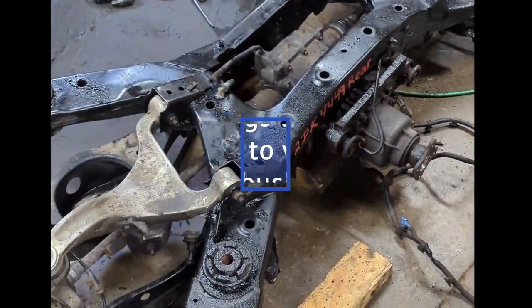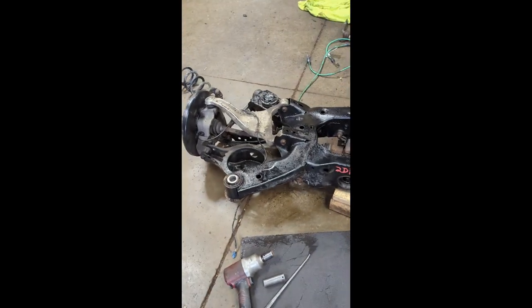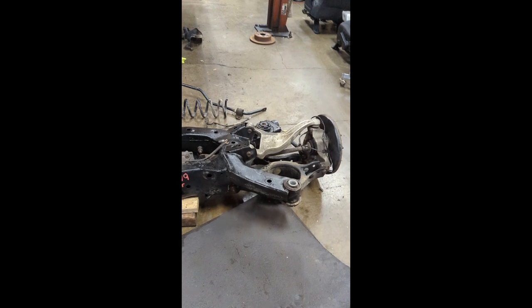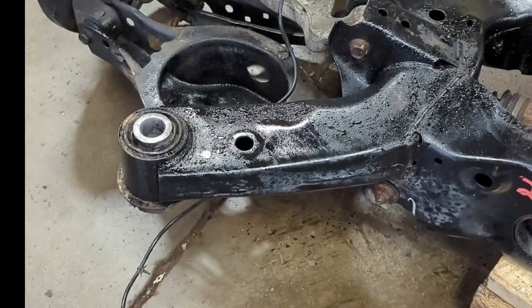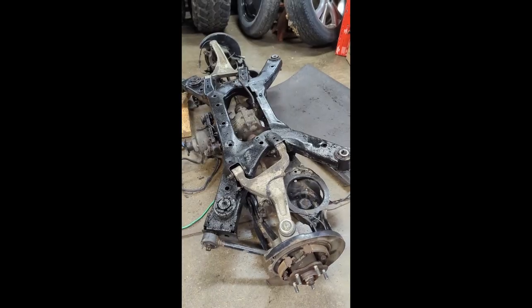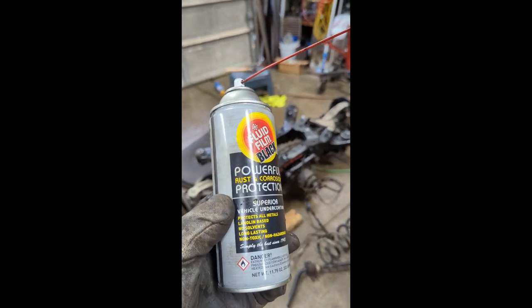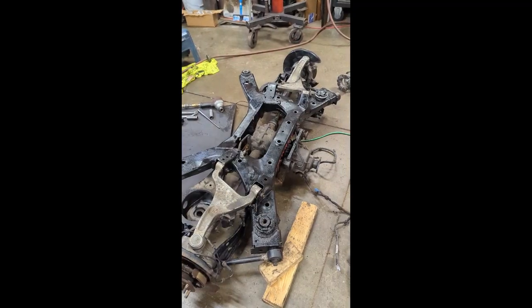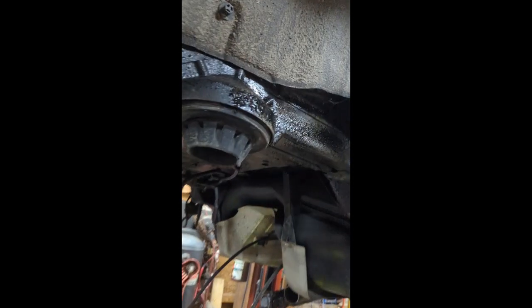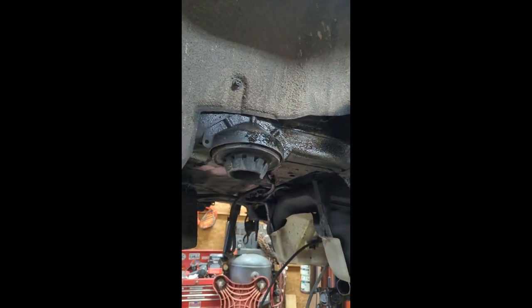Here we are with the new K-member over the top of the diff and the knuckles and all the pieces we pulled off. Got all the bolts back in. I just need to run the ABS lines, set the springs in, and then we're going to slide this up underneath the car and lower the car onto this. Put the nuts on these four mounts. Here is my new mount I had to put in — this is what caused my delay; I had to wait three days for this to come in the mail. What is the shiny stuff all over the new parts? This is fluid film — basically it's a rust inhibitor that keeps the rust at bay, so hopefully this is going to make it last a lot longer than the last one did. I also sprayed all up in here on the body while everything was out, trying to keep the rust away. Getting up there later is going to be hard to do, so might as well do it while everything's pulled out.